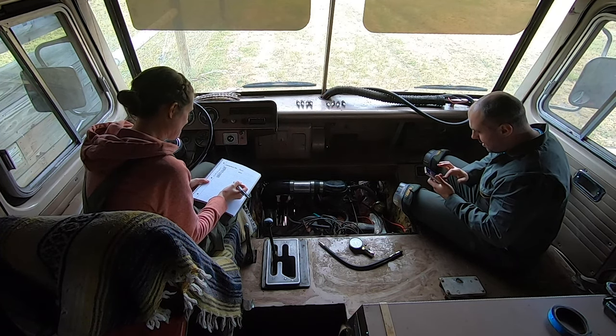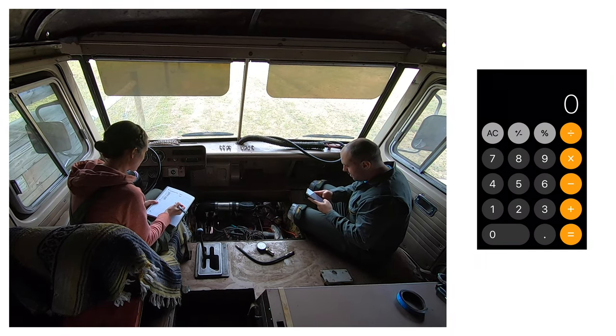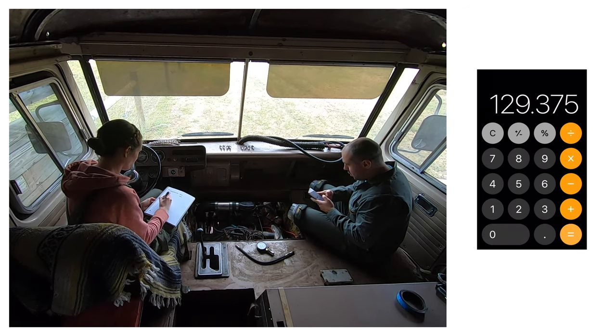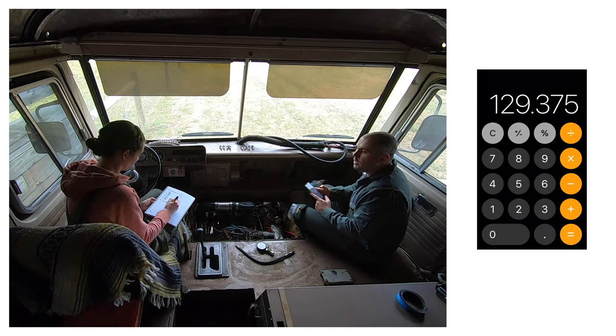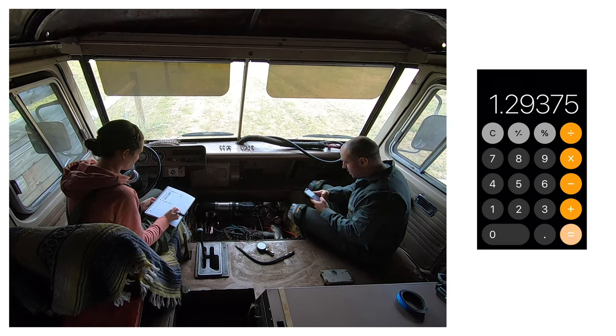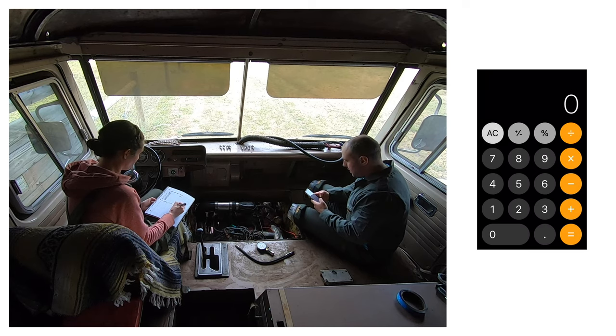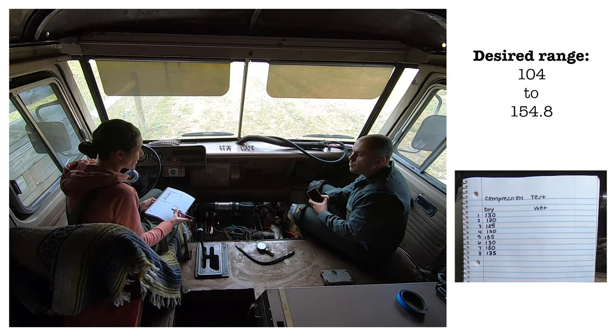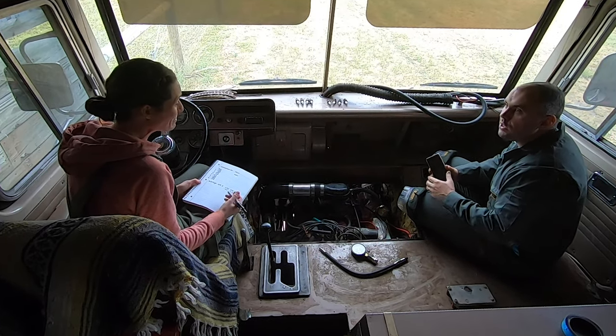Let's get a calculator going. The numbers are: 130, 130, 125, 120, 135, 130, 130, and 135. The average is 129.3. And they're all definitely within 20% of that — the upper limit is 154.8 and the lower limit is 104. So they're definitely well within that; they're all pretty much perfect. That should give us a lot of confidence that everything's good with the engine.